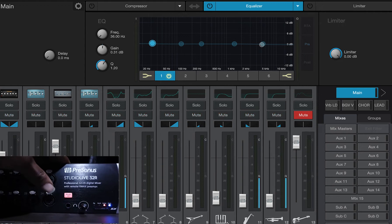The second feature I love is what I call the all mute button — it has the ability to mute all inputs and outputs including effects. This is really handy especially when you're done with a show. I'd advise anyone to hit the all mute button before shutting down the unit, so when you turn it back on at a different show, you don't get any spikes or sounds that could blow up your speakers.